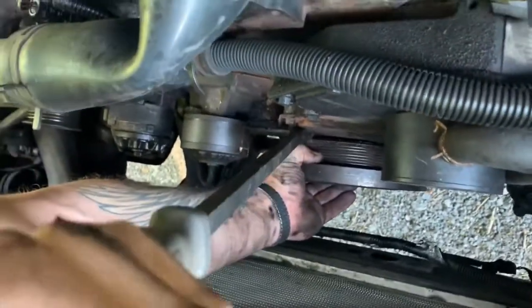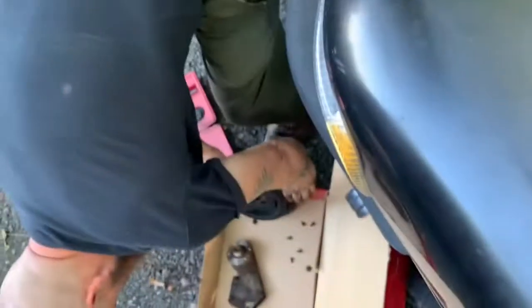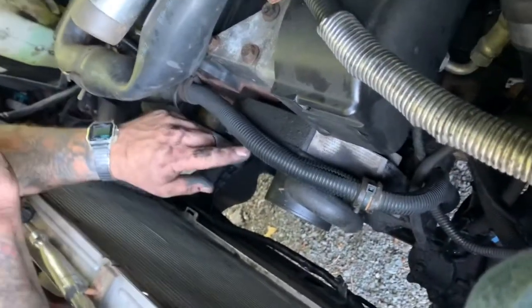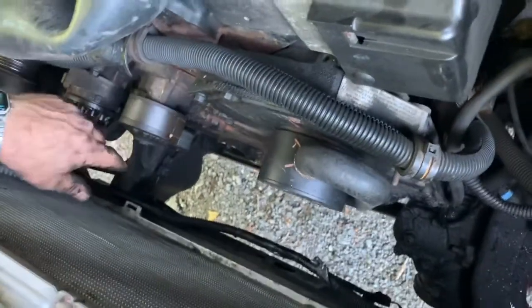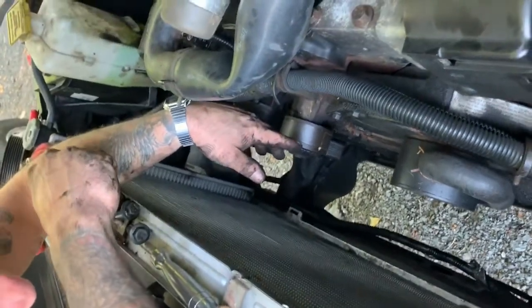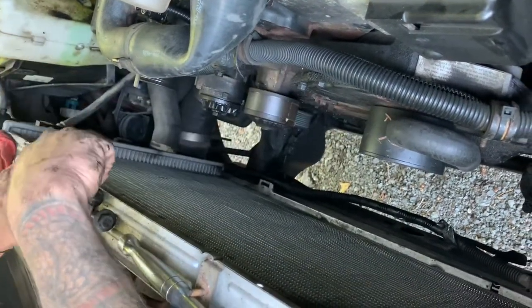Just gently pry this thing around. Loosen it up. Off she goes. And then next, you need a 10mm socket, and take all these cover bolts out. So I'm taking the timing cover off, then we're gonna do the seal from the back side. You can do the seal from the front. It's just, I'm gonna check the killer dowel pin, so might as well just do everything at once. And while we're doing that, we can reseal this cover. So that's why I'm doing it this way.